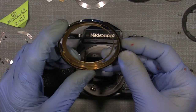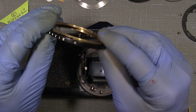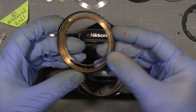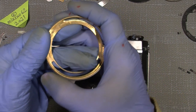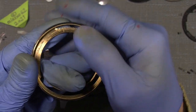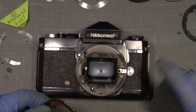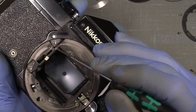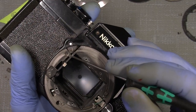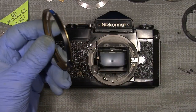I'll start with the shutter speed scale ring — the shutter A gear ring. They are connected together with three pins and it's not really meant to be taken apart. There is a scratch mark, a little arrow, and it has to align with the same area on the shutter B gear. This alignment mark is important so things are lined up correctly.